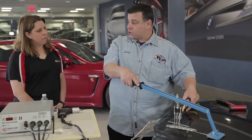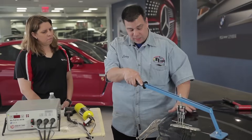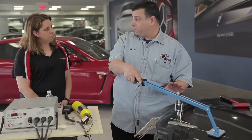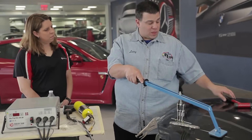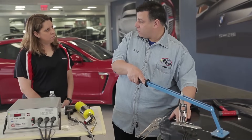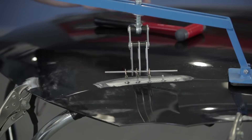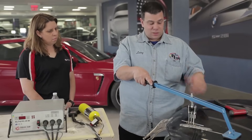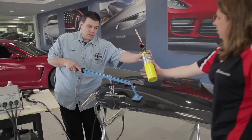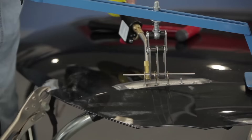This would normally be on the car, held shut by the hinges and hood latch. As I'm pulling and I have tension, I'm going to feel it lift easily as I heat it — you don't force pressure, you just hold it there and feel it come up. While doing that, I'll need to lightly put some pressure around the area to keep the high areas down and raise the low areas. Very light pressure, because you're working on something that's hot. So I need to hold the torch, the non-contact thermometer, and this lever — which is why you need four hands.